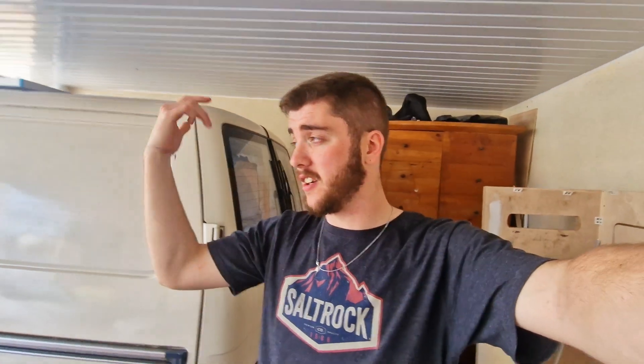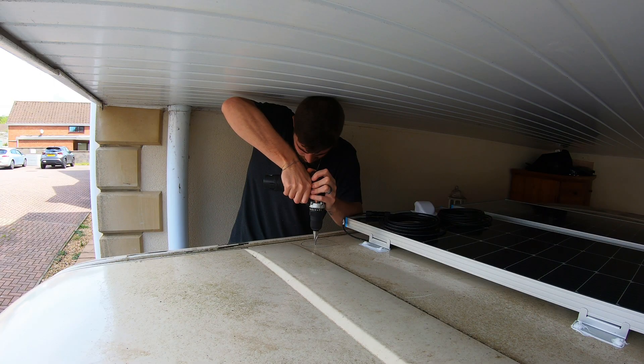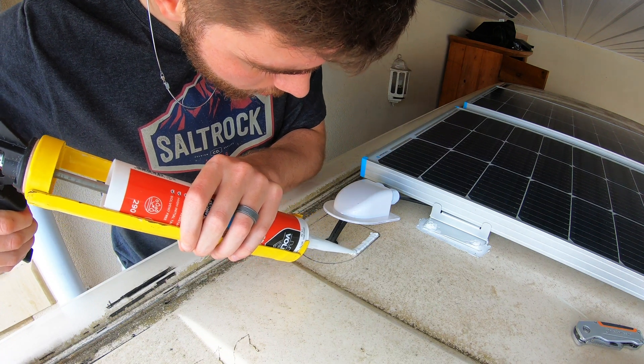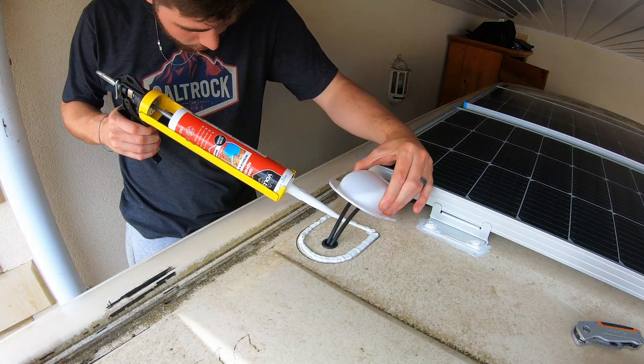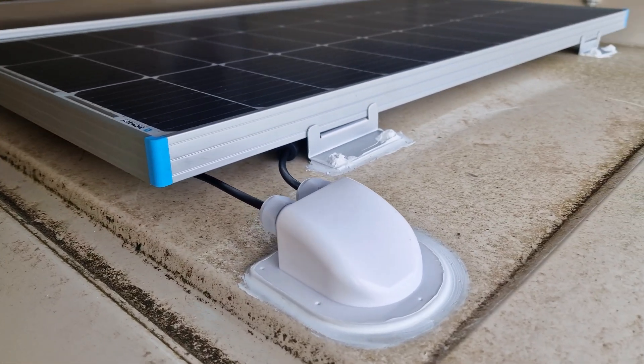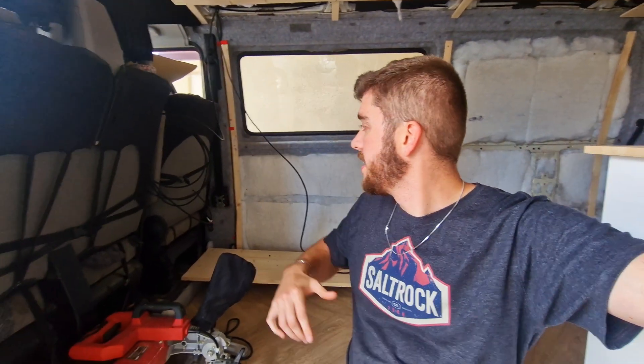All right, got the solar up on the roof. Wanted to put the panels lengthways but they just didn't fit, so they're on sideways now — sealed to the roof and also screwed down through the roof as well, so super super solid. Now all I've got to do is do the solar entry just in front of the two panels so they'll run down and go straight to where the electrics are going to terminate. The cables are now running through to the van — label them positive and negative because you can't tell otherwise. Top tip if fitting a solar kit: make sure you label it positive and negative.